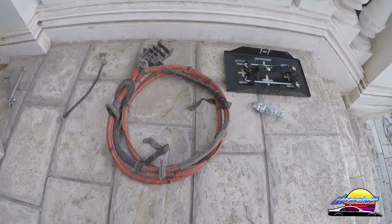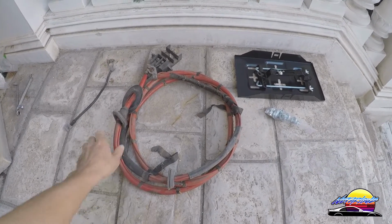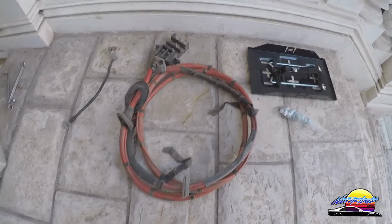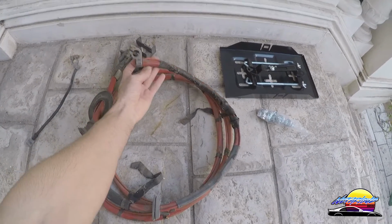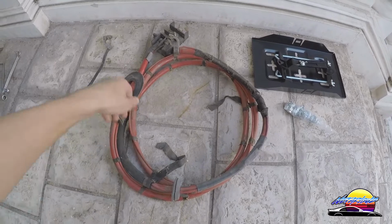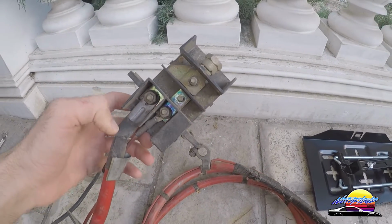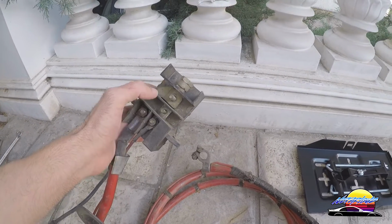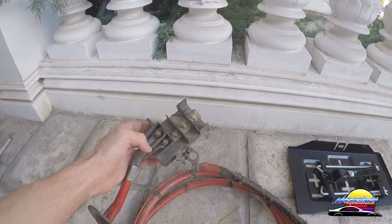So first things first, you need to get the equipment and all the parts that you need for this. You're going to need a battery cable. Now, I like to use a battery cable from a BMW E36. The reason why is because they've already got the terminal attached and it's a good quality one. It's a real fat cable, and they've also got this cool little distribution box you see here where you can attach the battery cable and then attach all your bits in the engine bay, such as the starter motor wire and everything, right to this terminal here. And it makes it really easy.